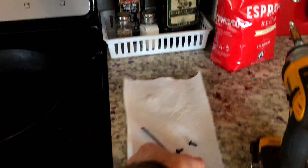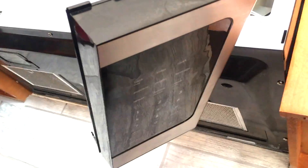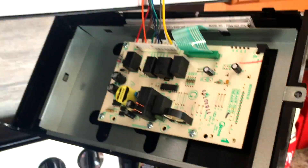Your face panel is going to come off, but it will take some wiggling, so gently put a screwdriver all around this area and this area as well. Just try not to scrape the nice surface. Eventually it will come off. Then you're going to want to take that little screw out right there, which will take the control panel off, and then you will have access to all of these goodies right here.